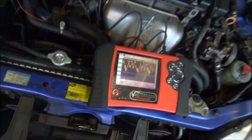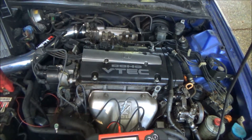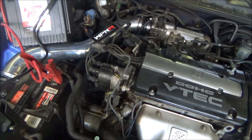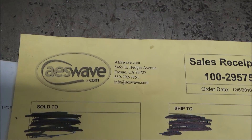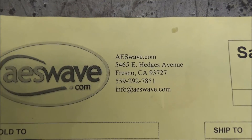That's why you always want to check this before you start replacing parts on a car. Also, if I had taken the spark plug wire off that cylinder and grounded it out, the waveform on the oscilloscope for channel 2 would have been better. Here is all the information for the company that made the high amp probe — AESWave.com — good to know.